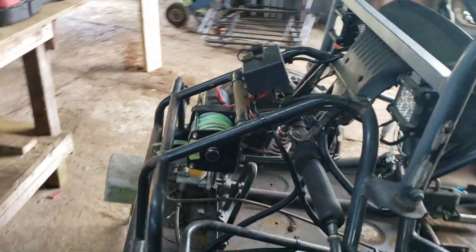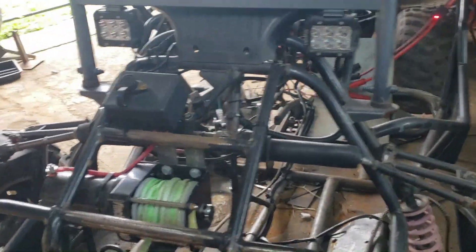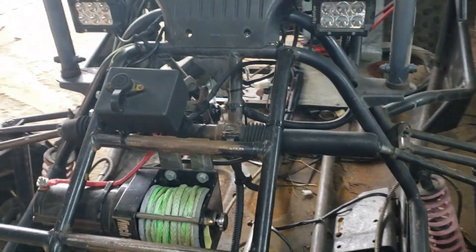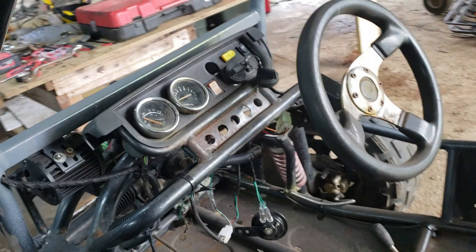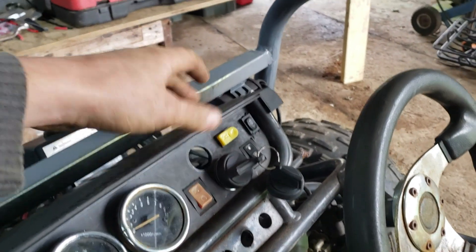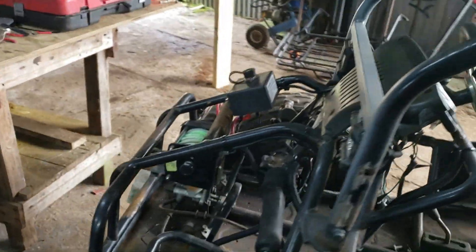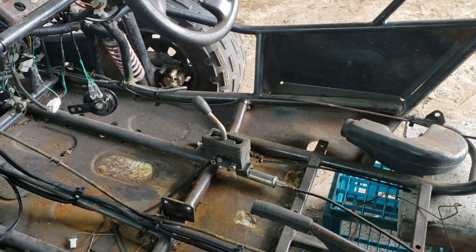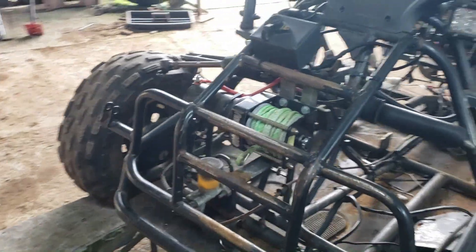So the loom's all in now. I've hooked up the wiring and lights, got the winch connected and wired into the dash - that's on a switch. I've just got to tidy up some of the wiring behind the dash. Got that mounted, got the horn in there, ignition, lights, winch in and out on the dash, which makes it a lot easier - less hassle. I've still got to work on getting the gear shifter in and the cable mounted for it. But for the meantime, I'm quite happy with how it's coming along. It's good.